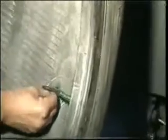Put the pulling wire through the hole from the inside and pull the edge of it from the tread side to drive the stem into the hole. The drawing out work is completed when the adhesive surfaces of the stem appearing both inside and outside of the tire are roughly equal. The portion appearing on the inside surface of the tire is cut off with a cutter.